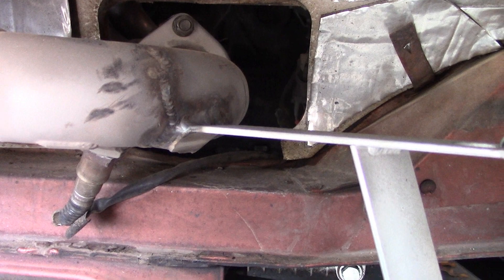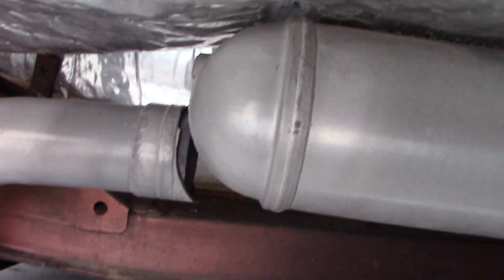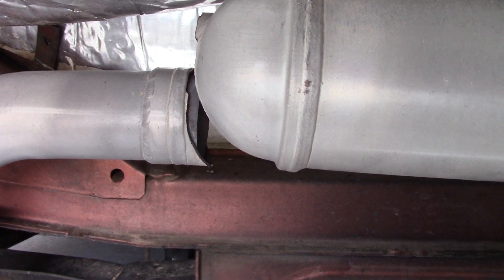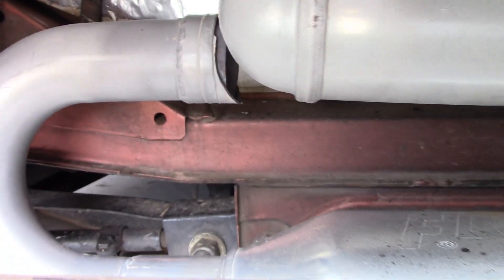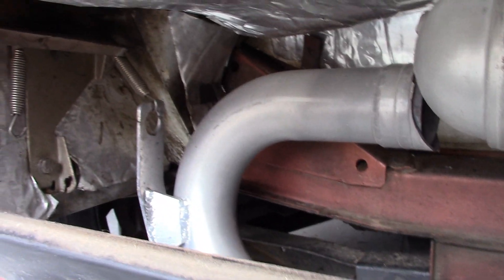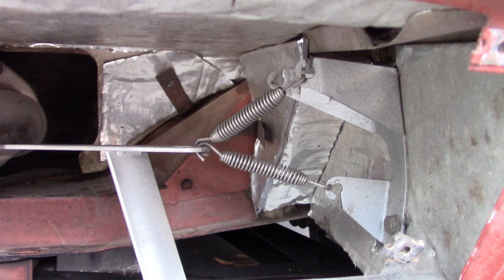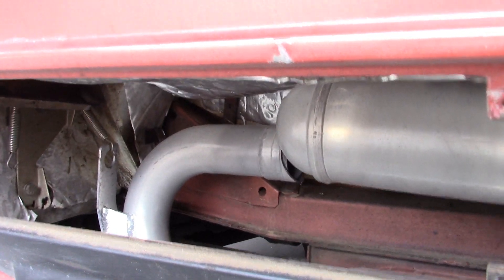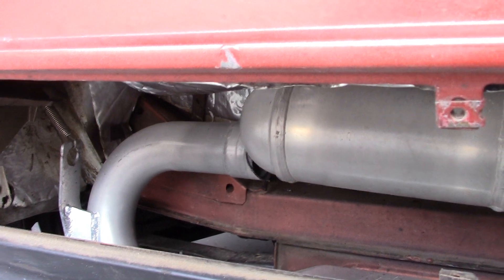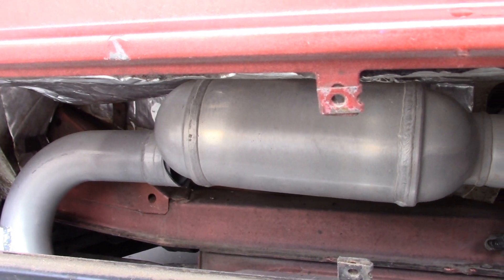And then last night, the big surprise — I went from pretty quiet to full loud. And that is the catalytic converter. As the exhaust gas exits the catalytic converter it fails to go into that pipe, which makes it really loud. This is an engineering problem. Part of it is these springs and the way this exhaust is designed to sit in here really isn't intended to be used very much. When you go bombing down backcountry chip-sealed roads with a stiff suspension and then go out on a racetrack with a lot of torque from the motor, something's going to give.